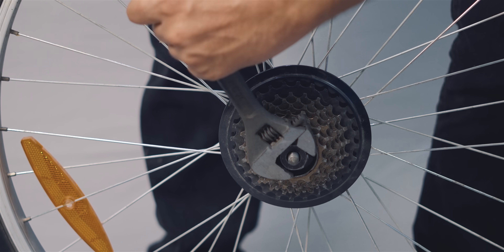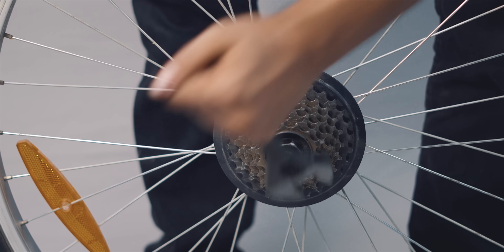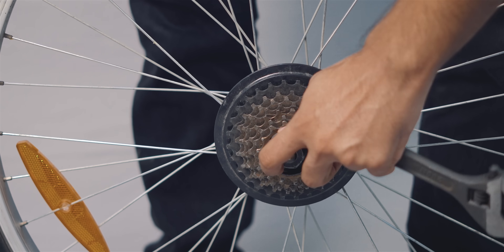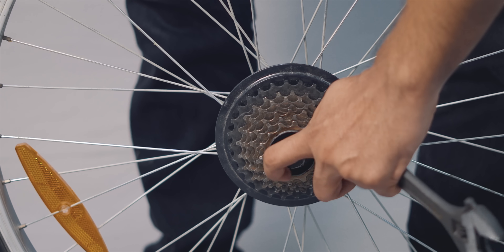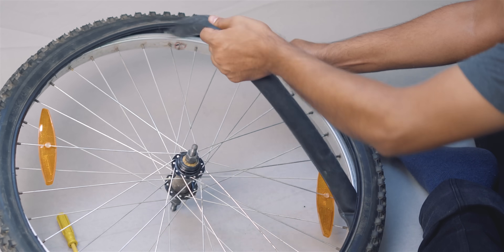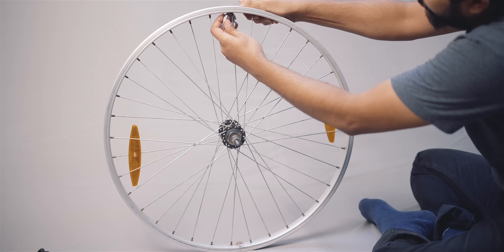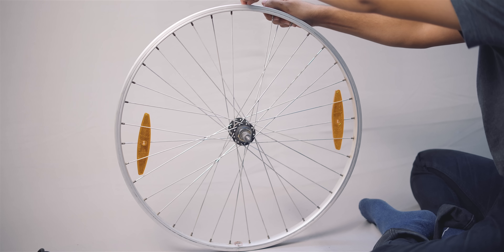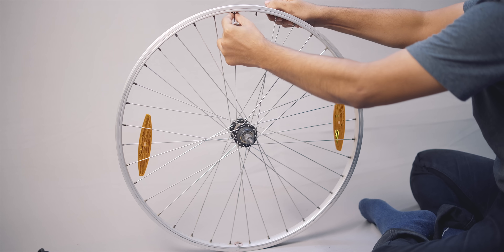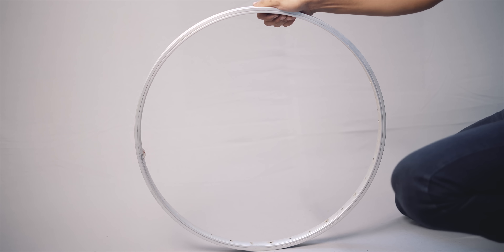Unscrew the nuts on either end of the wheel hub and pull the wheel gently away from the bike. Here comes the most exhausting part of the entire process — unscrewing the freewheel. The freewheel screws in the direction of the wheel, so as you continue to pedal it gets tighter and tighter. If you can't open it yourself, go to a cycle shop and they'd happily do it for you. Once the freewheel is off, remove the tire and tube. Use the spoke wrench to unscrew all the spokes — we just need the rim, tire, and tube. You can keep the old hub aside; if you want to go back to pedaling in the future, you can use it again.